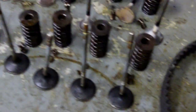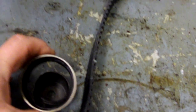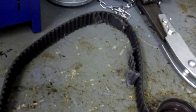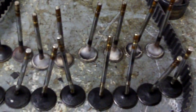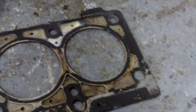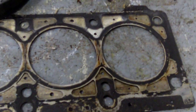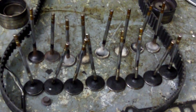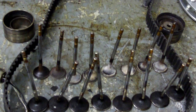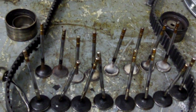When the belt ripped, well — in conclusion, you have to decide: is it worth it to spend extra money to get the idlers? After this little fiasco, I think I will be putting idlers on everything I put a timing belt on — just good practice. 16 valves are a pain to change, as you can see they are really bent up. Also had to put in a new head gasket and a few other things — seals, valve cover gasket, and such. So ask yourself: do I want to spend 150 to 200 dollars, or do I want to spend 40 or 50 dollars and just get the pulleys and do it the right way?